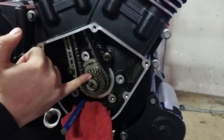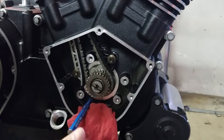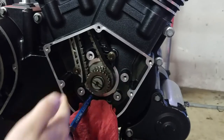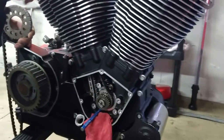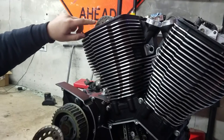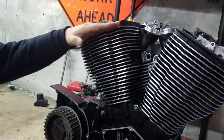Remember how we talked about the keyhole? It'll still face this front cylinder. The other part is, here's your dowel rod — your dowel will actually fit right back inside of here. So you've got everything lined up at the front, just like what you do with the rear. Remember how we talked about the hash marks on the rear cylinder? You'll know that you're at top dead center because you'll actually see those two hash marks are now aligned with the cylinder.